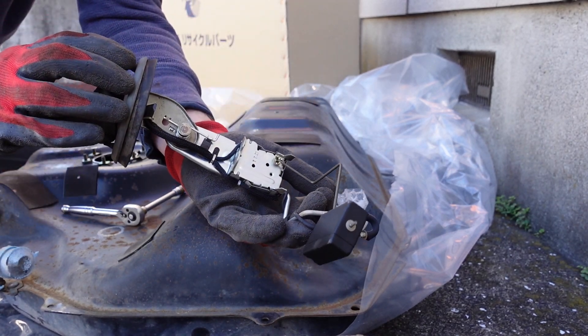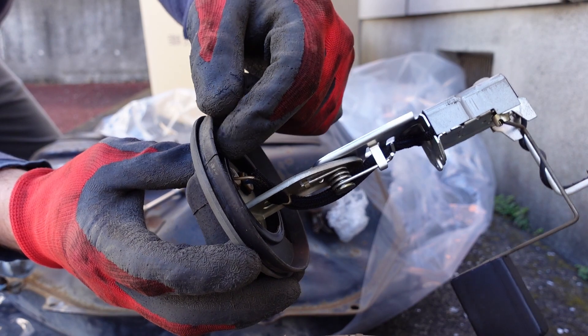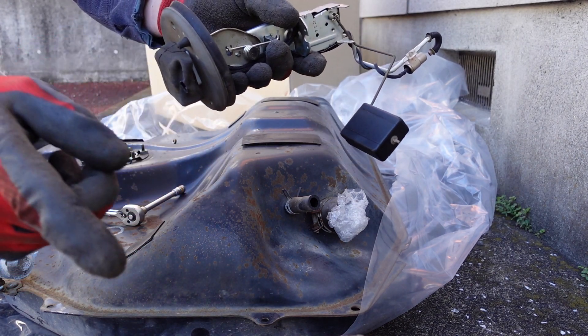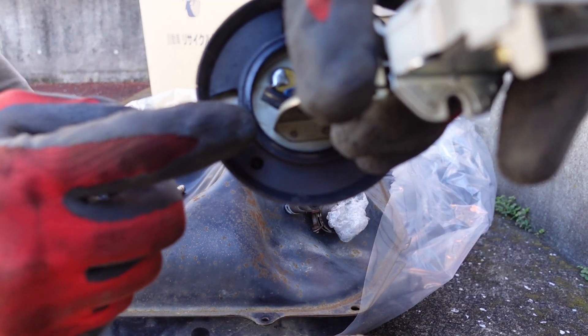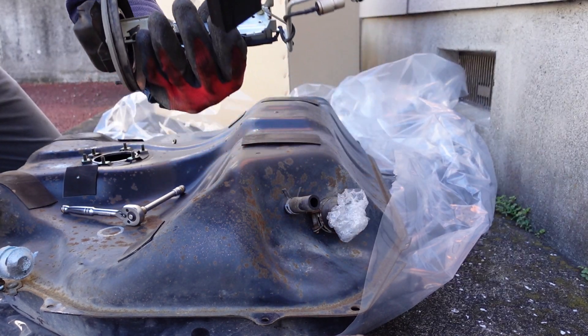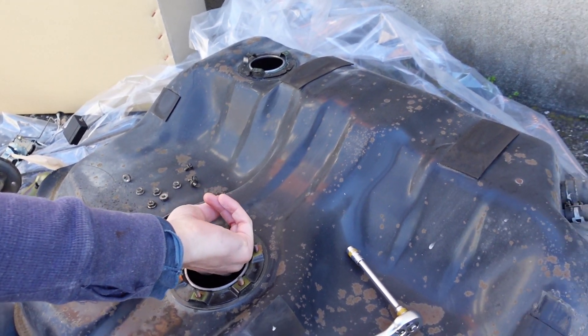Look at that — it's just so new, unbelievable. The top is cracked out here so that might have some vapory smells. I might try and see if there's a replacement gasket for that — mine is the same way except ten times worse. Technically the seal actually happens down here on the inner one; it's not cracked all the way through but it would be the time to replace it. What a win! We'll give it the old hand check on the top side because that's where condensation can collect with a half tank of fuel. It's just as fresh and shiny feeling as the inside looks — what a win, this is amazing. I'm gonna pull the fuel pump on my tank to compare.